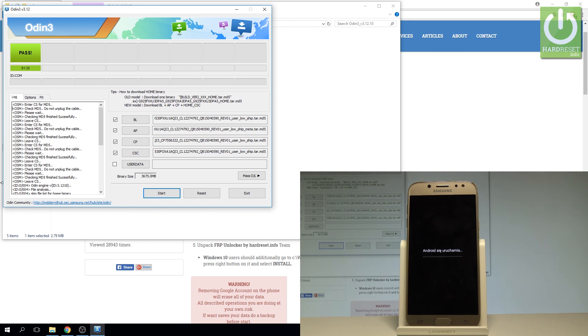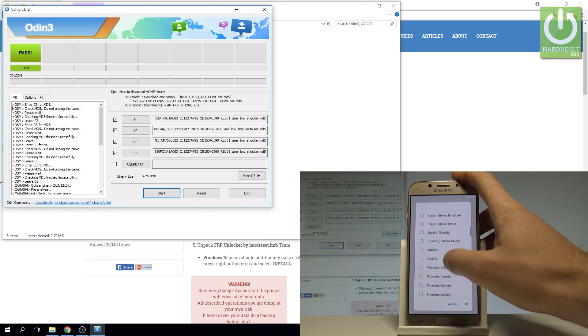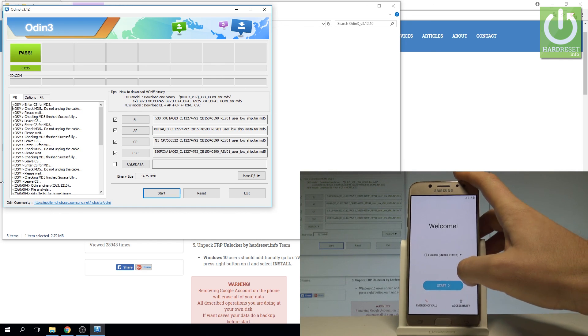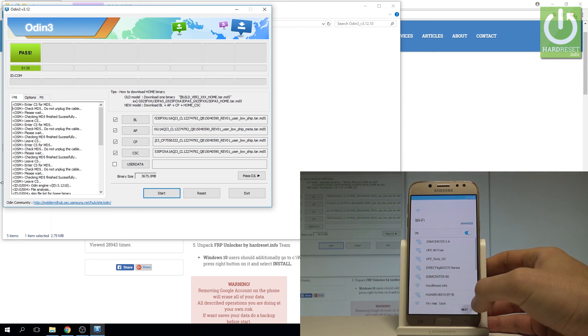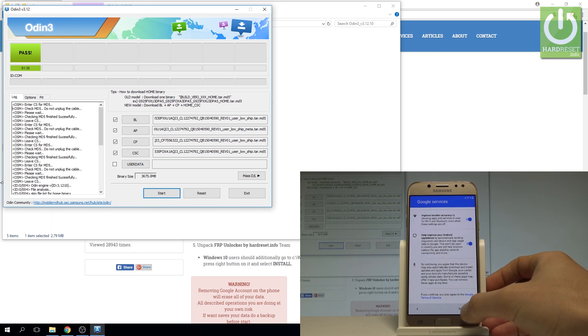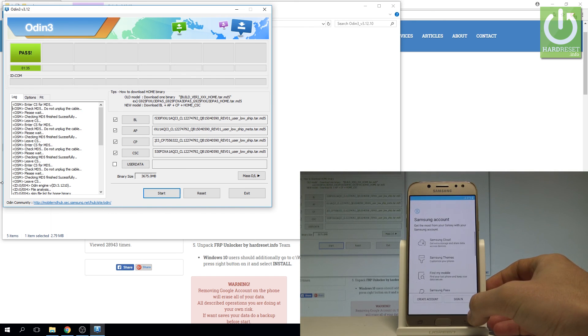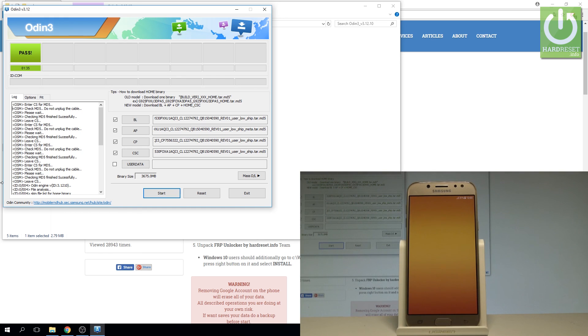Android is turning on — let's wait a few seconds. Let me change the language to English. Tap OK, excellent. Now let's quickly go through the welcome panel just to activate the device and confirm that the factory reset protection is no longer turned on. Tap Next, leave everything as default, don't protect the device with a screen lock — skip anyway. Skip the Samsung account, tap Finish Later. That's it — as you can see, you can activate your device without a Google account, which means everything went well and you have fully erased the factory reset protection. Thank you for watching, please subscribe to our channel and leave a thumbs up under the video.